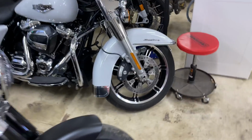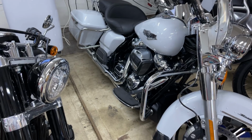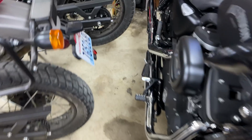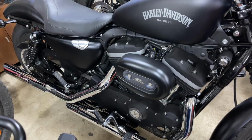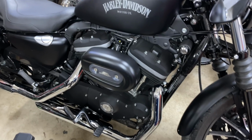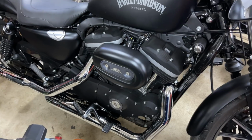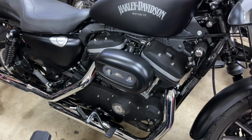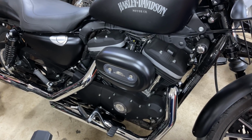But nowadays, you plug it into the diag port and it Bluetooths to your phone. It's the coolest thing ever. But yeah, the air filter, the slip-ons, and the mapping just woke this thing right up. When I ride it, I never ride this thing and go, man, this thing's gutless. I was shocked when I had the three different 1200s. Just the 1200 kit gives it a 40% increase in power. And that's all this is, pistons and jugs. Well, the heads are different too.